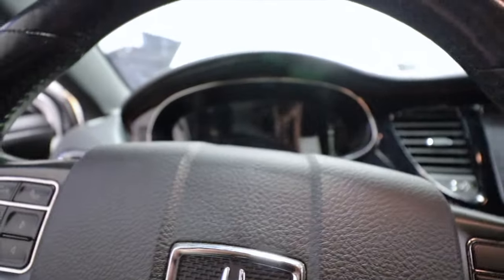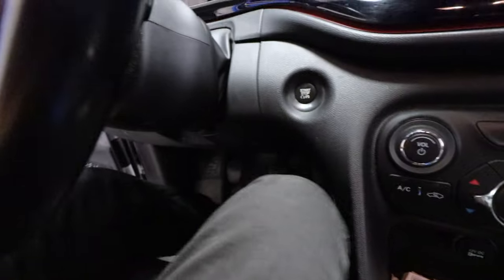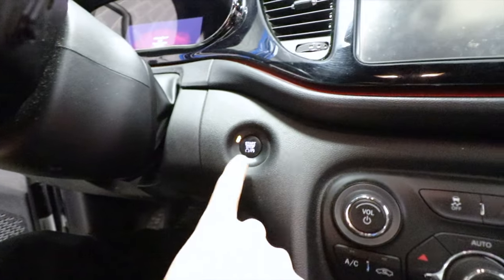And with that said, we're gonna go ahead and start this car up and hope that the wheels will spin. Wish us luck. All right, so moment of truth. I've got the clutch all bled and I plugged the battery back in so the dome lights will not turn back off. But let's see what we got. All right, so brake pedal works. And the clutch pedal works, it has pressure. That's promising. And here we go, push the start.